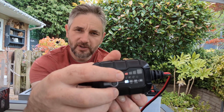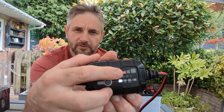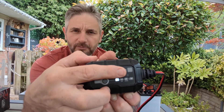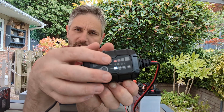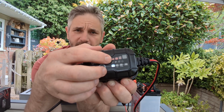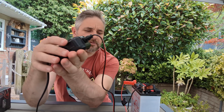This is a pulsating charger — it's trying to recover this battery now. It hasn't lit up with the failed light; that is a dead battery. The lights go red, red, amber, green, and they do pulsate. I put this on one of the other bikes yesterday and it quickly cycled up from red through to orange very quickly, then went to green and just pulsated slowly.